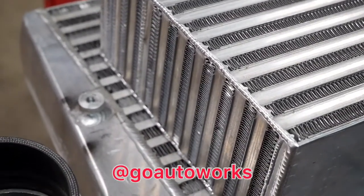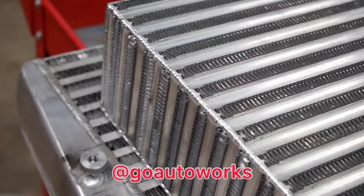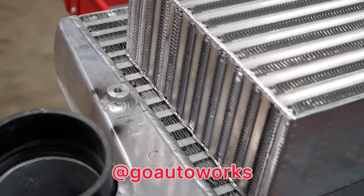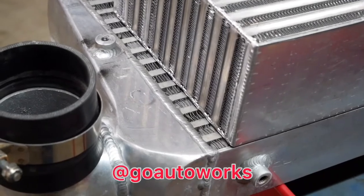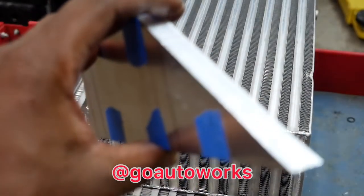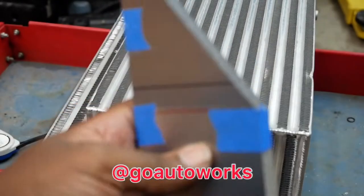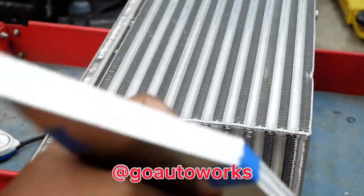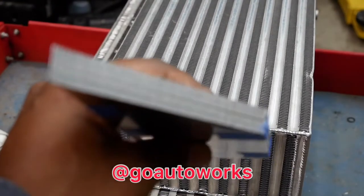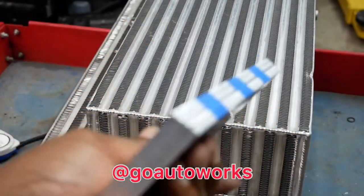One thing I am going to do - you see that bung on that tank - this car already has a set of mount brackets welded to the frame rail, so I'm going to reuse that location. On the intercooler tanks I build, I'm going to put a similar bung so that it bolts in the same way and gets the same overall height as before. Here's a tip for some of the new fab guys that want to build intercoolers: I always draw and cut each intercooler by hand, and to get each one exact, the best way is to do them all in one cut pass. That way there's no deviation in the height of the tanks, so when I get ready to build and break the end pieces, I know the four side pieces are going to be the exact same.